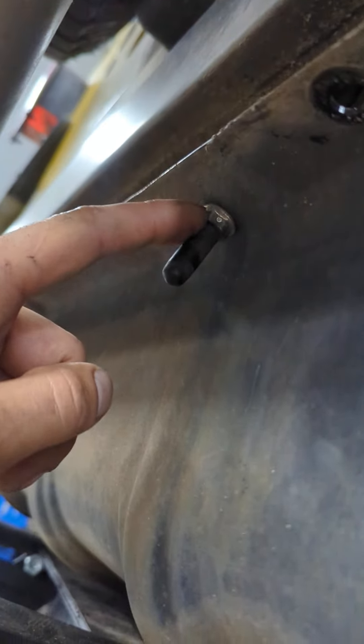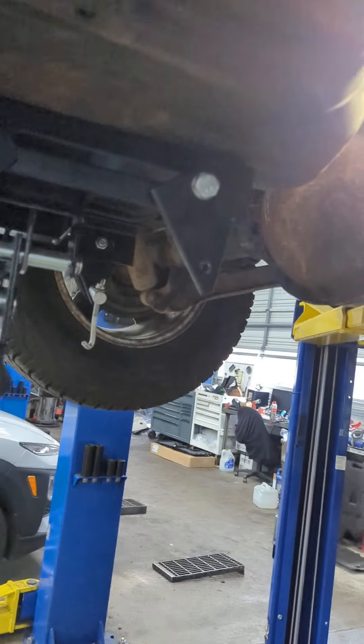Don't mess with these — that's what holds the cover and the tank together. It's four bolts from this side and three from the other side. Unplug those few things, disconnect them, and you can drop the pump right down.